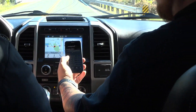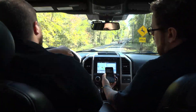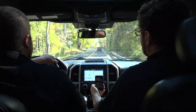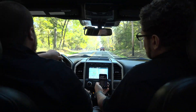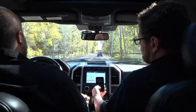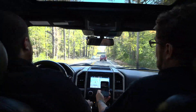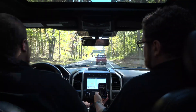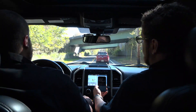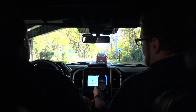We've got the Amped app open and you can see we've got economy, stock, drive, sport, and extreme modes. Right now we're cruising along in economy mode. In economy we're in the lower settings — a little less aggressive and just easy driving. Now if you want to go to extreme, we can feel a big power jump in between that. Oh wow — I didn't even move throttle position and it was able to pick up quite fast. That's unbelievable, from one end of the spectrum to the other you gain quite a bit of immediate throttle boost and some more power right away.